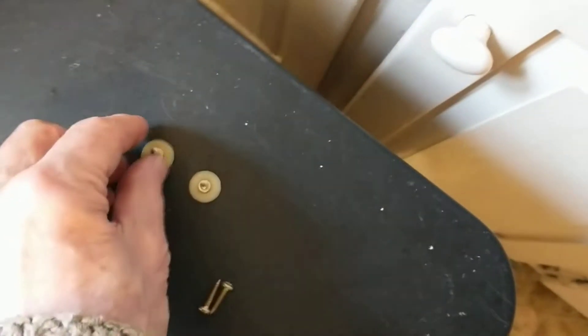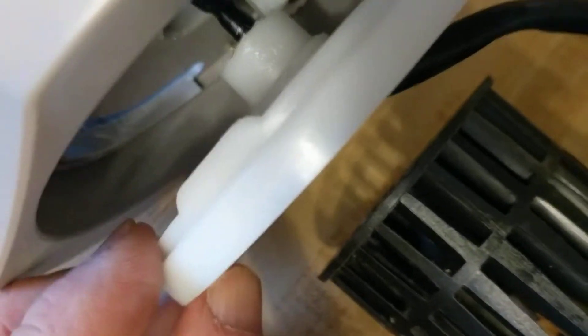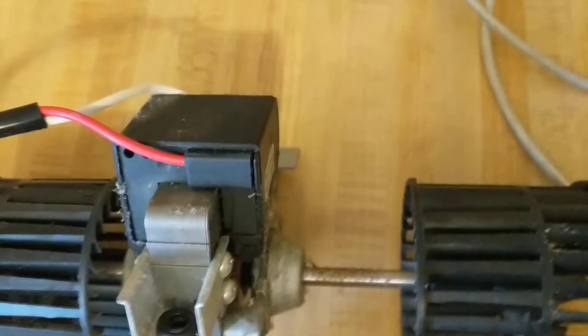Once you remove the base, you'll still need to remove two screws with Teflon washers that hold the base to the oscillating structure. After that, you separate this plastic piece, which comes apart easily. I also removed the motor because when the motor is inside that cage you can't get a Q-tip down inside. Once it's off, you can run a Q-tip along both sides of the blower.